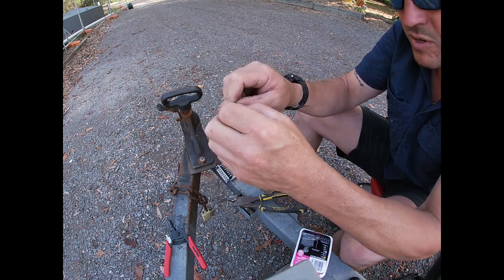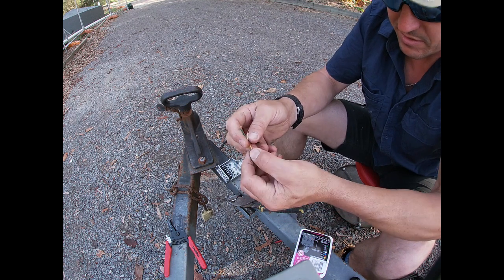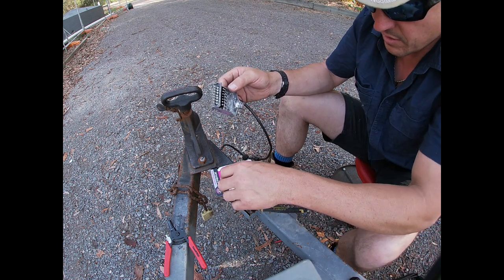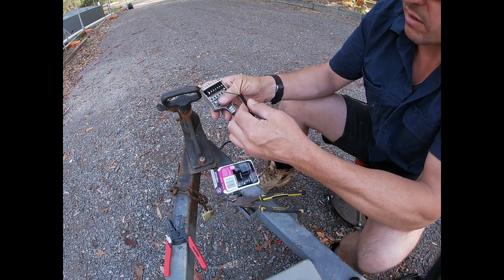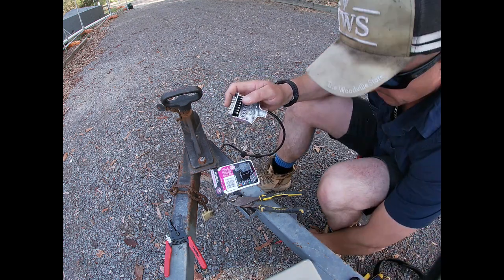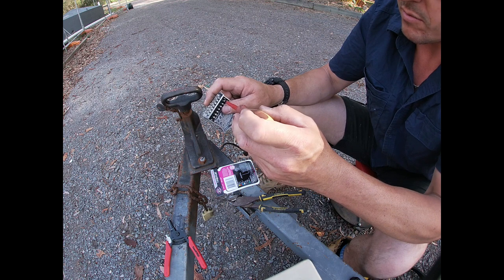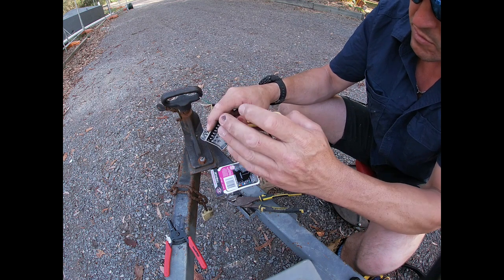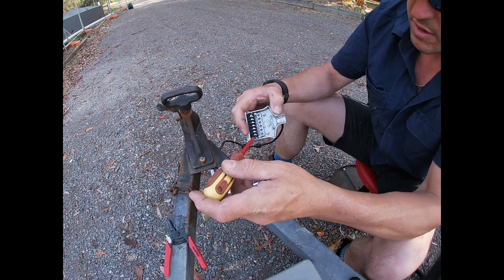You can tin these — the process of heating them up and putting solder on them — like I said before, but it's a bit of overkill here. So we've got our diagram. Green is the right indicator — and on here that's this one, going like this. Opening up the terminal screws so the hole is clear inside. I need yellow, green, red, white for earth in the middle. Don't wind these screws all the way out or you'll lose one.